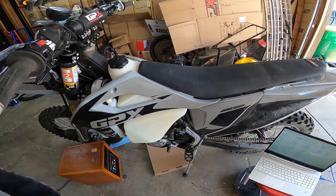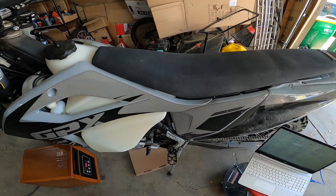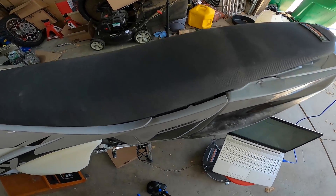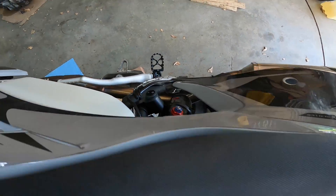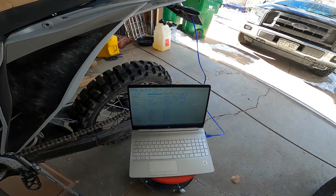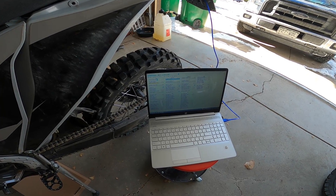I have a broken ankle, so I can't really ride this thing, but I've been playing with the ECU some more. We're going to start this up with a normal OEM map, let it warm up because it's all snowy and cold outside, and then we're going to try my switch which switches over to a secondary map within the ECU and watch that on the diagnostics. This should be set — I put it at 14.2 AFR, so it's a little different than stock.